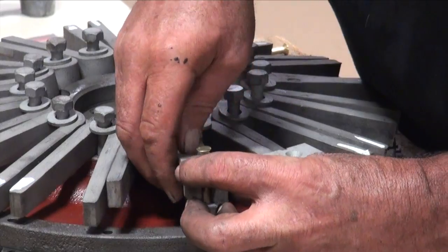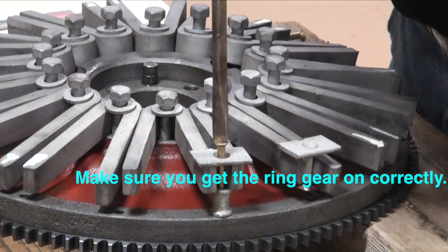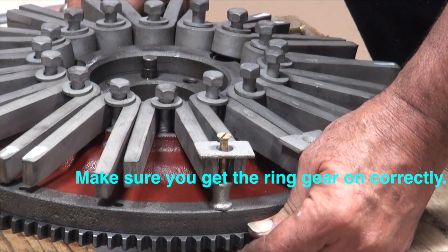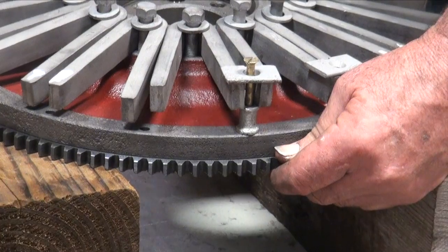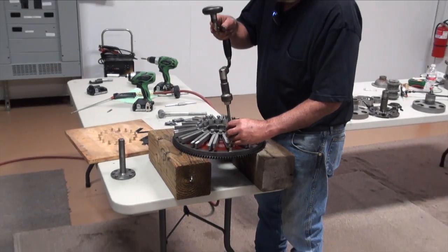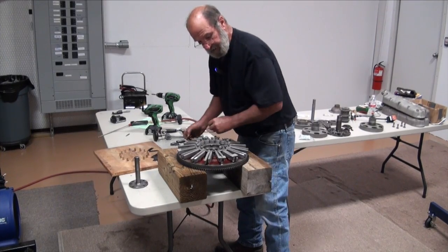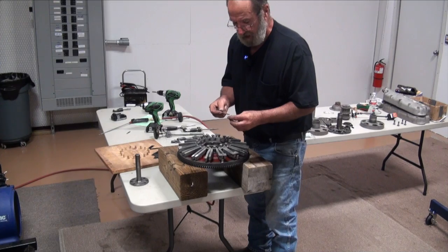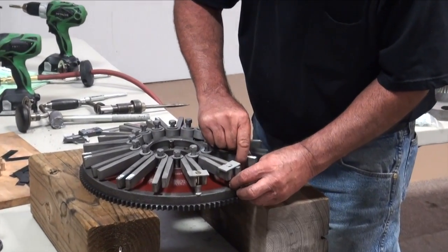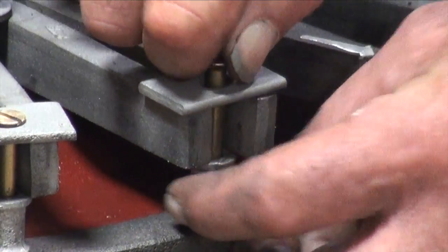Just get them set up, and if you had a drill motor with a flat screwdriver you can get that started. I'm going to run that down, get it started into the ring gear — sometimes you've got to dink with it a little bit to get it to start. I've already checked my magnets and my spools; they're roughly about three-quarters of an inch plus or minus a few thousandths. Sometimes these vary quite a bit, so I like to at least have something that's pretty close to the same size, because again we're trying to get to that air gap.